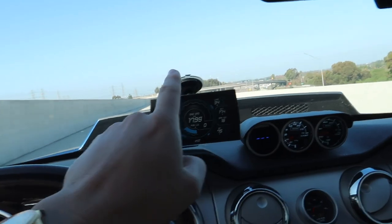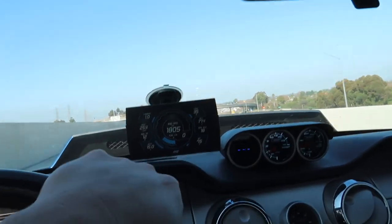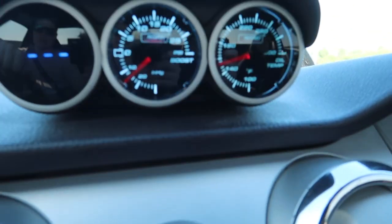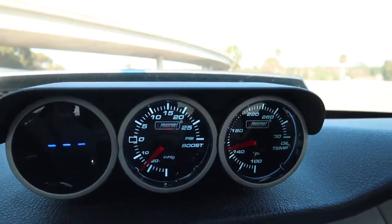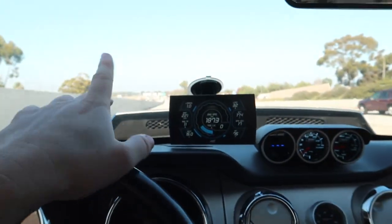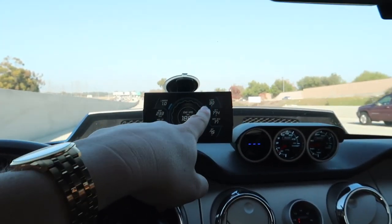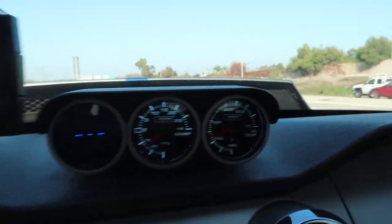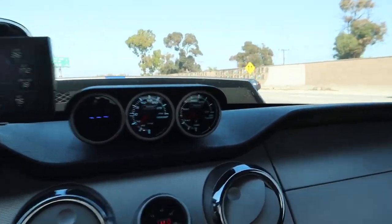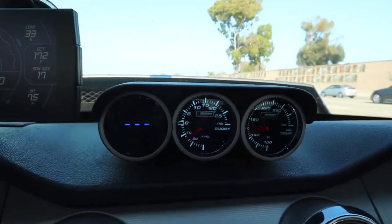About the oil cooler being too efficient — we've been driving on the highway for about 5 minutes and the temperature is just chilling around 150°F. The coolant temp is at 175°F. When it gets to 180°F it seems to read correctly, but on the highway it just runs too cool. It's too efficient, apparently.